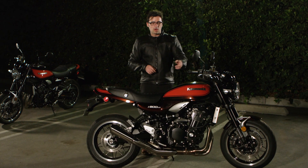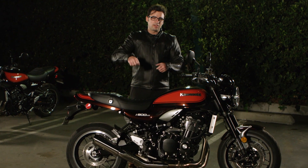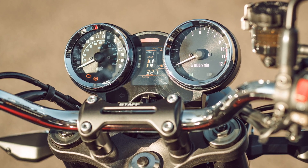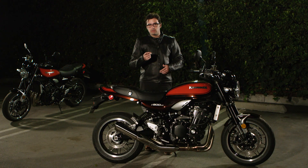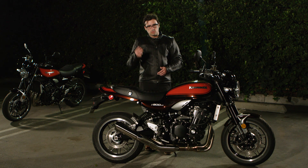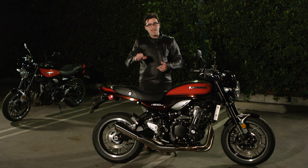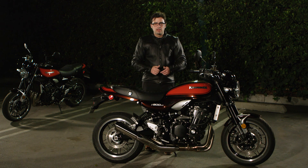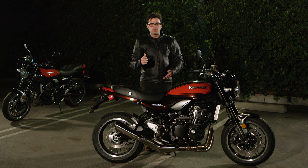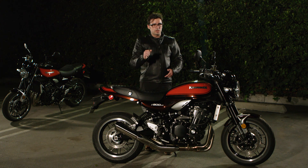One criticism I do have is that the throttle is a bit binary — very on/off on that initial throttle input. When you're getting on the gas it's going to feel a bit snatchy. In the KTRC — the riding modes, traction control modes, and general safety package available on this bike — you have level one, which is the least intrusive and most aggressive throttle response. KTRC2 is the most intrusive in terms of ABS and traction control and has a more slack throttle response, so in that mode the throttle isn't as twitchy. A twitchy throttle matters because if you're mid-corner and need to get on or off the gas, this can be a bit choppy and chuck you up into the seat if you're not careful. You really have to be aware of that and readjust your wrist calibration.